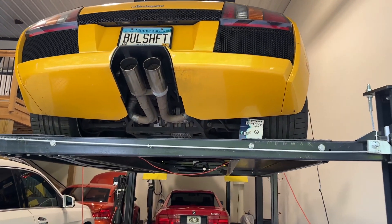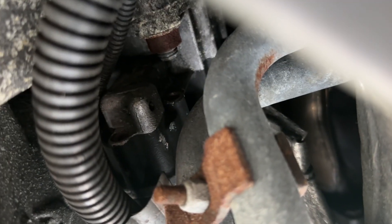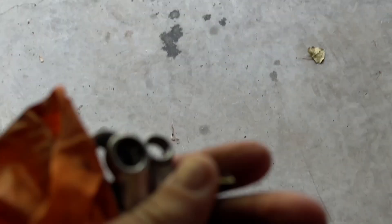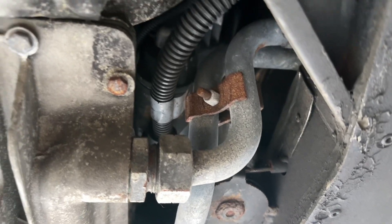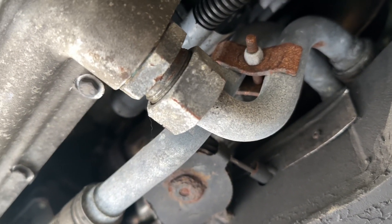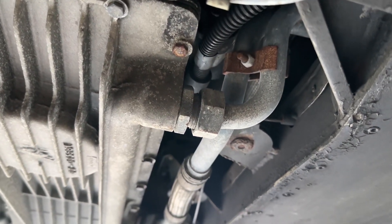It's really hot out, but I'm at least going to try to get that solenoid off. First thing I'm going to do is get at the back of it here and see — oh, where are we even? Actually right up in there. There are three Phillips screws — you can see two of them recessed there. My goal is to try to get this little guy up there and see if that works. Then I'll pull off the battery positive and put it in a glove so it doesn't arc out on everything.